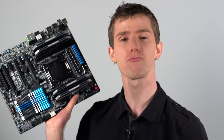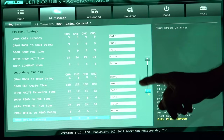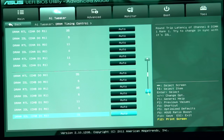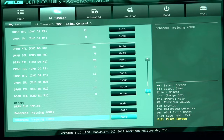I said "normally" an awful lot of times in that last shot — there's a reason for that. This is a quad-channel kit. Could I install it in a dual-channel board? Sure. Would it work? Probably. There are primary timings which the manufacturer tells you, so if it doesn't detect correctly in your dual-channel board you could easily change them around, but there are actually more timings. Some boards will give you access to secondary and even tertiary timings on the memory that can be optimized to work with a particular platform.